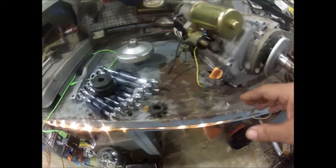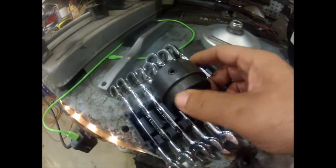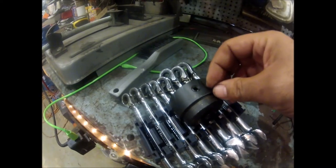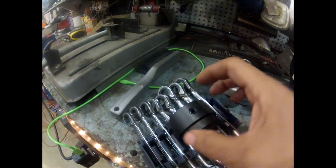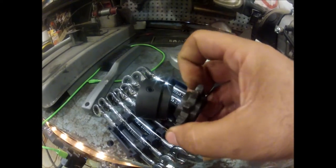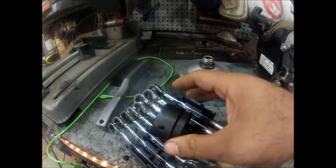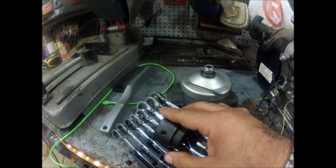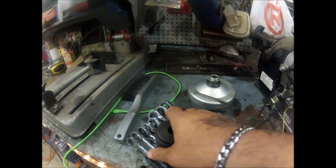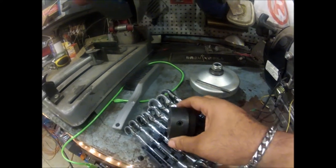What I'm getting ready to start with is this measurement — 0.195 inches. That's the thickness I need to get this hub down to, duplicating the thickness from the edge of the tooth to the complete back of the original piece. These hubs are easily purchased — I believe from Tractor Supply — they have different hub sizes, hole sizes, and keys. You find what size gear you want and what size hub, and you make it work.